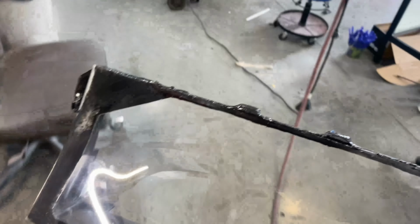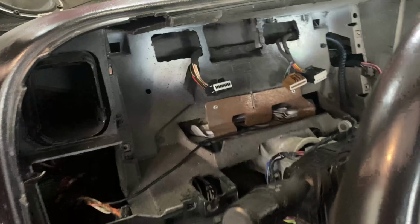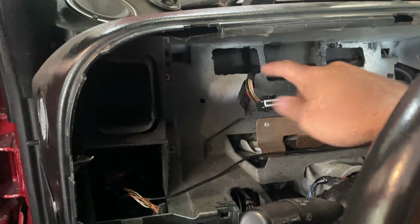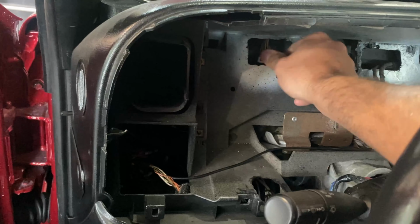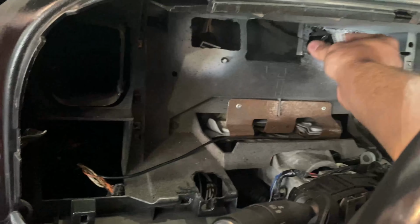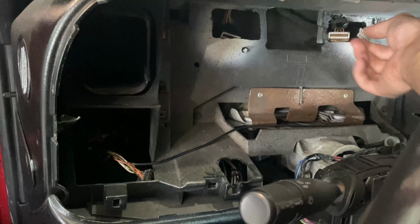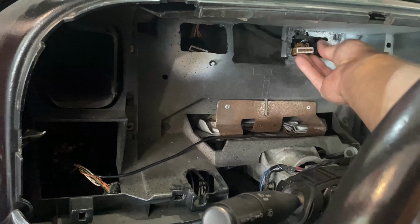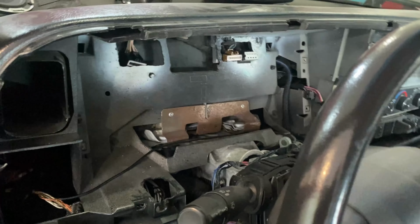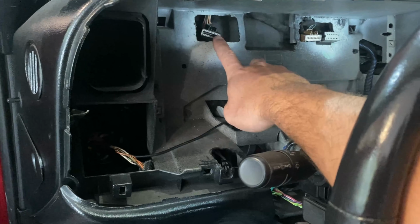If we bring the assembly to the truck, there's a few things that we have to do on the truck side for the cluster to fit, and that would be these holes here. These holes aren't here from factory. So this is the harness from the Dodge truck. These holes are made so the connectors, once the cluster sits in there, have somewhere to sit. Otherwise, the assembly won't be deep enough at all. So you have to make these cuts in order to fit that cluster in there.